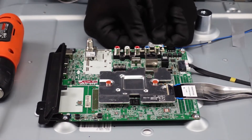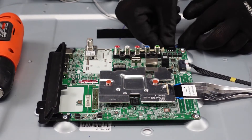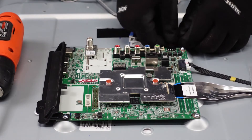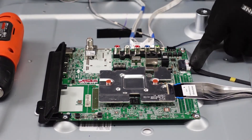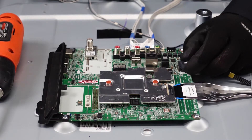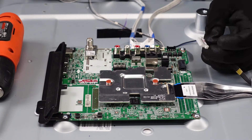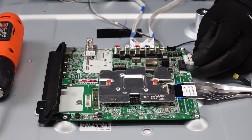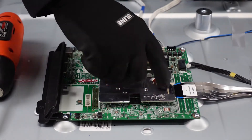This connector here has a lever right in the middle — press down to release that latch and pull it directly out. It goes to both speaker wires, so be very gentle pulling that one out. This one: pinch on the sides to release and pull it directly out. Sometimes when pulling this plug out it'll come out on one side instead of both — if that's ever the case, just plug it back in all the way and restart.